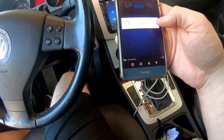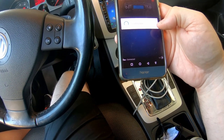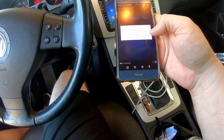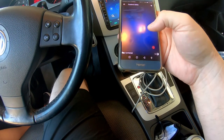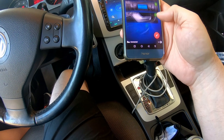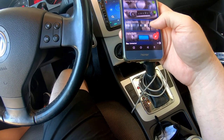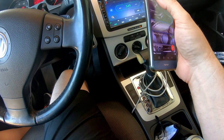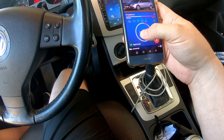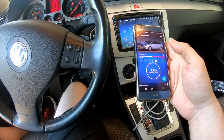And let's see what the other one is, if there is another one. Digital radio, which I changed the radio, that's probably why. It's not able to scan it because the radio's, yeah, that's it, control unit not responding. So I think everything else is fine. I don't know what that cooling fan was about, but the engine code has not come back. So hopefully this helps somebody, and I will see you next time.